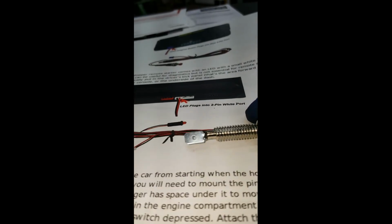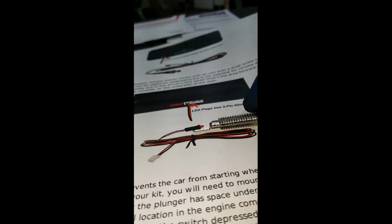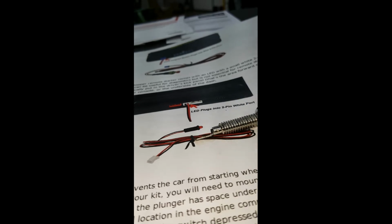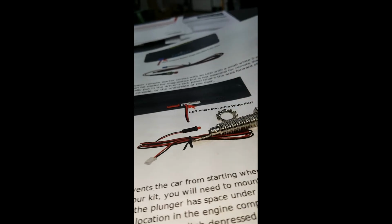Okay, we're going to explain this hood switch here. It's got this tang on the end of it. It's where the wire plugs in, the one that we just soldered an extension onto. And you got the threaded body that goes through the hole that we drilled that has to make contact with metal. So it comes with a star washer right here that will cut through the paint when you tighten it up to make contact with the metal.